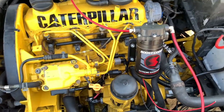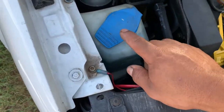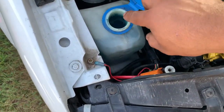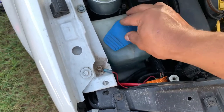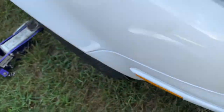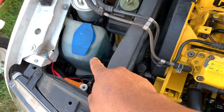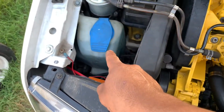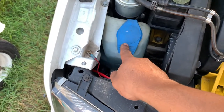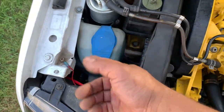This is the next morning and this is where I left off last night. I got the line done - I was showing you guys the drilled bottle, I put some mixture in there already. On the bottom I drilled and tapped and put the hose in. This pump will be fed from that windshield washer bottle, so I don't have to rewire a warning light to tell me when it's empty because the car already has that from factory.